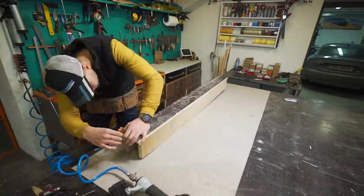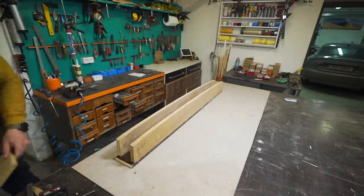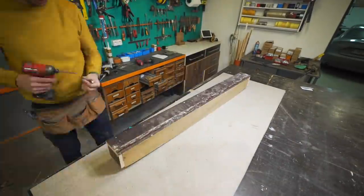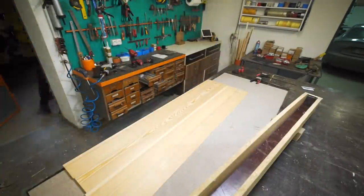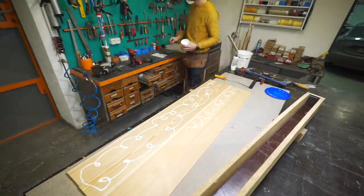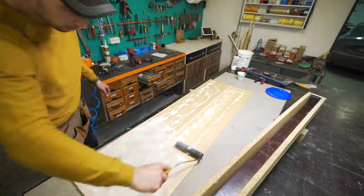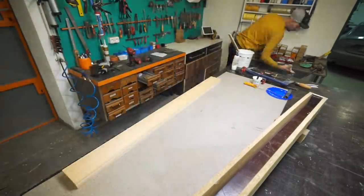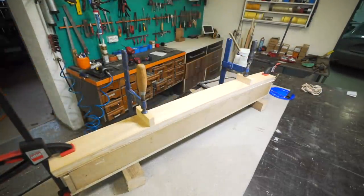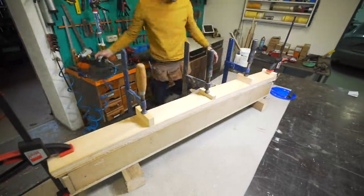This mold that was used in our last van is going to help bend our new attachments to the exact curve of the van ceiling. The wood is much easier to bend when it is thinner, so each attachment has multiple layers of thin wood that are being glued together. Then all of the glued layers are clamped down to mimic the shape of the mold. These need to be left overnight, so when the glue dries, the wood has all bent together.